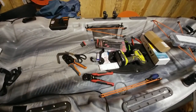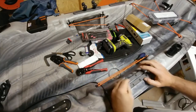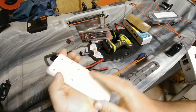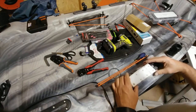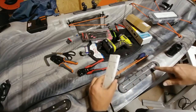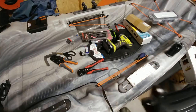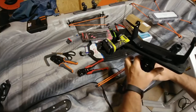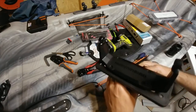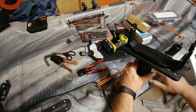What I did was I took the short screws out of the Scotty track — two, four, six, eight of them. I took a piece of cutting board — this is just a rough cut, I didn't really round it off. I lined it up with the holes on the Scotty track and used longer screws to run through the cutting board, through the Scotty track, and into the kayak. The reason is the seven inch unit is a pretty good sized unit — if you only have four screws going into this plastic, you're only putting the load on those four screws. I used the cutting board to spread the load across eight screws.